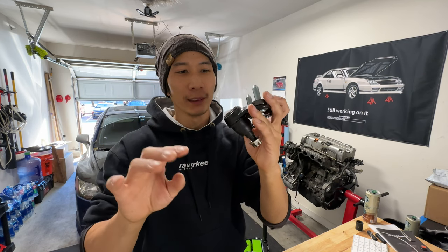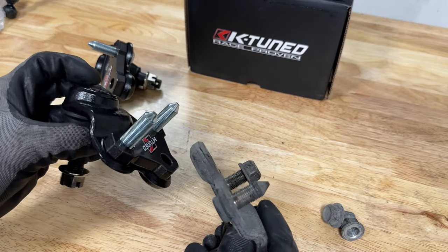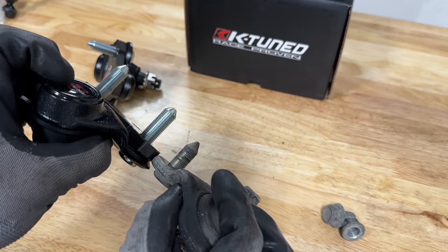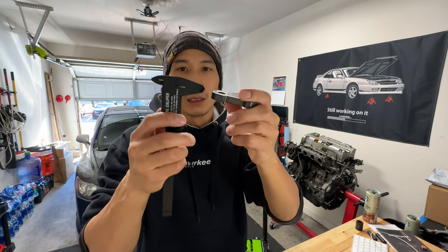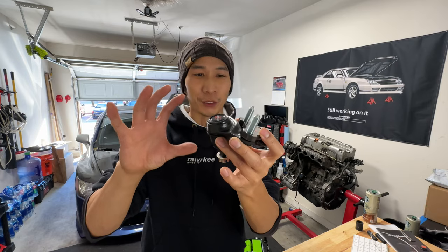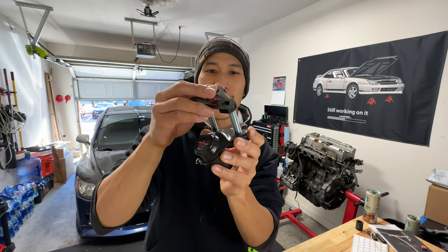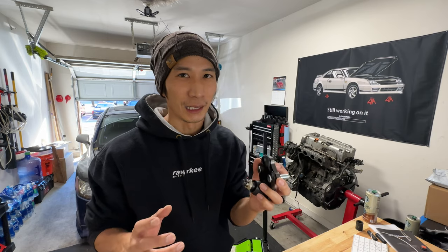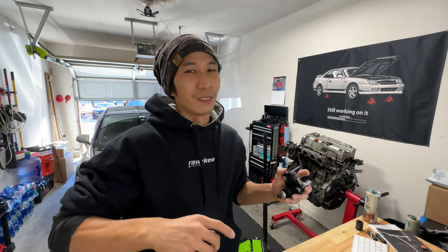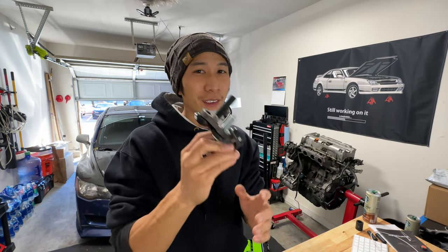K-Tune actually offers two ball joints — they have the regular ball joint for the Civic, and this is the roll center adjuster ball joint, which is pretty much the same thing. The only difference is they include this plate right here. It measures to about 10 millimeters, give or take — so this is 10 millimeters taller. I'm assuming they made this part 10 millimeters taller to compensate for the plate they added. Most definitely you're going to need an alignment, because when you change suspension pieces, the smallest adjustment can throw off the entire alignment. So adding this 10 millimeter spacer is going to mess something up. If you get this, I highly suggest you plan on getting an alignment right after you install it.